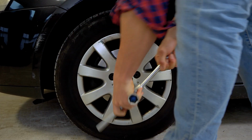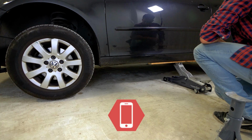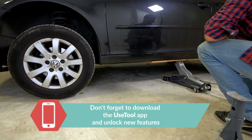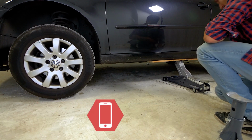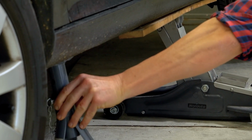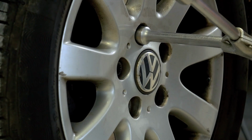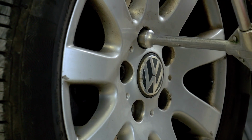In order to change the brake pads on your vehicle, you will have to raise the front of the car and take off the wheels. This will provide you with full access to the brake pads. Loosen the stud bolts on the front wheels, raise the front of the vehicle and put it on 2 axle stands. You will then be able to take off the wheels.